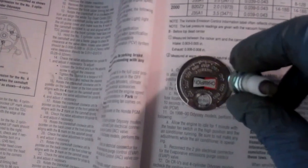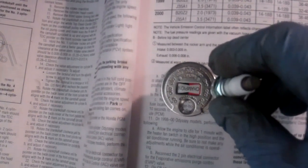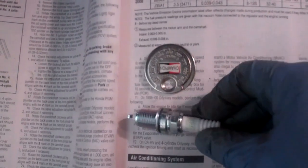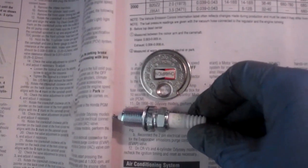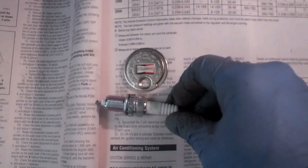I've already gapped these. I ran it along the edge, it was too narrow, and I just very gently kind of wriggled it without hitting the tip — just moving the electrode back a bit from the tip of the spark plug. Sometimes I've changed plugs and not gapped them, I don't really recommend that. But anyway, that's a quick and easy thing you want to do first: gap your plugs.